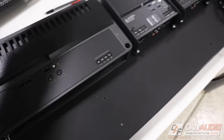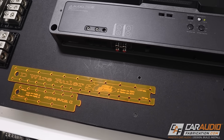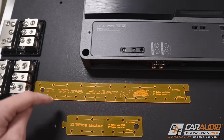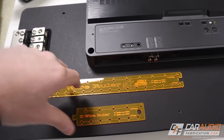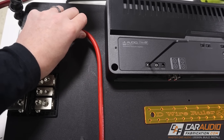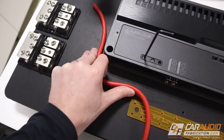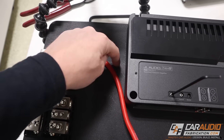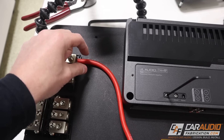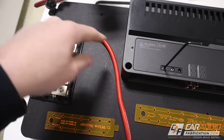I'm going to move the fuse block out of the way for now because we're going to start connecting all of our wiring to the amplifier rack. To do this I'm going to be using the D wire ruler from Five Star and Mobile Solutions — they collaborated on this cool tool. It allows me to quickly drill holes that I can use for zip ties to secure all the wiring to the amp rack. Before drilling, I need to think about the path each wire is going to take — you can push the wire in and get a feel for how it's going to bend and flow. For the longer parallel runs we definitely want those to be nice and parallel, so we'll be using that ruler. Let's start connecting everything up.